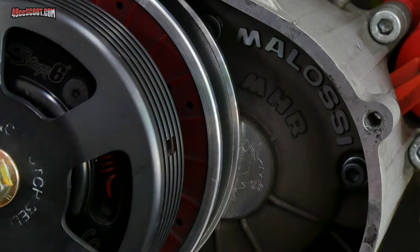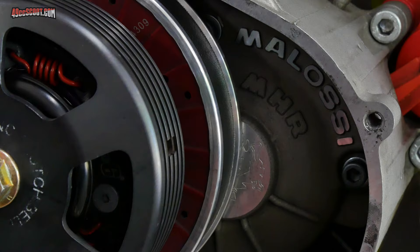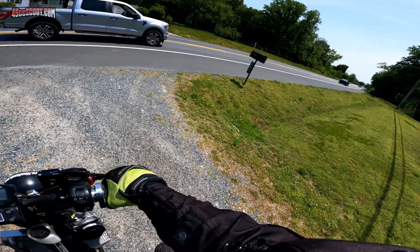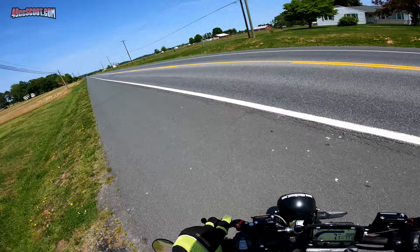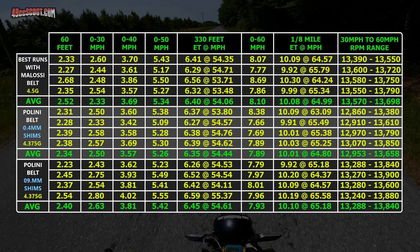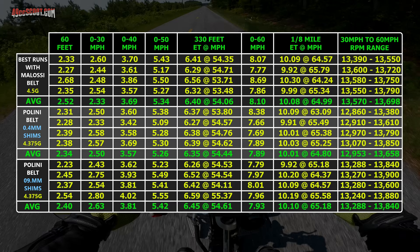That still wasn't enough to let the belt be free in the front pulley or reach the outside of the rear pulley, but I didn't want to risk stripping splines on the crankshaft by shimming too far. The runs still felt good — data showed I was keeping in the power band better at low speed but revving a little high on the top end. Movement from a stop was still a bit jumpy. I could have spent more time trying different weights, but I moved on to the variator instead, since I don't think roller tuning alone would solve the jumpiness caused by the poor belt fit.